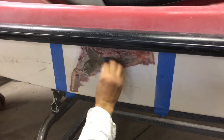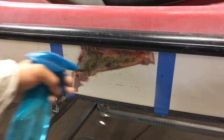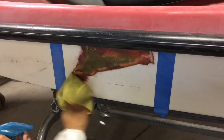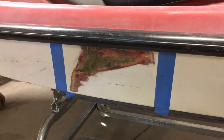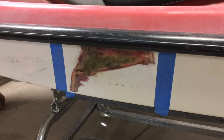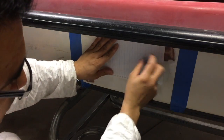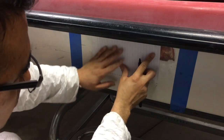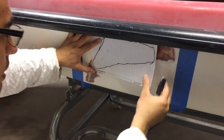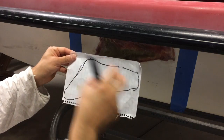150 grit. Now I'm gonna be using some isopropyl alcohol to clean this area up. Now that the area is clean, I can go ahead and start adding some fiberglass material. I'm gonna lay down a paper so I can make my template, then go ahead and cut this shape — as you can see, it's not as weird as before.